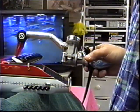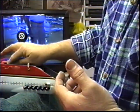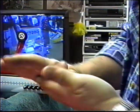But first thing I want to do is get the tank out. There's a problem with this, and when I put that third mounting bolt in there, let me put this over here. When I put that third mounting bolt, I forgot when I put this tank in, I need to allow for a little shim of some kind in the back so that the tank back is not rubbing on that bolt head, and obviously eventually it might wear a hole in the tank.